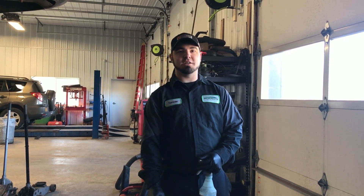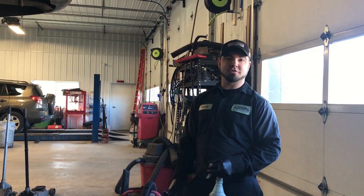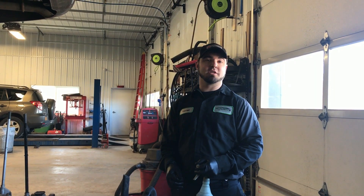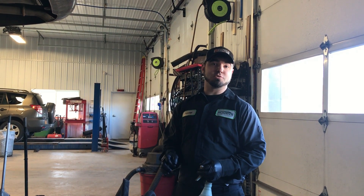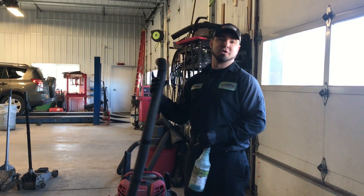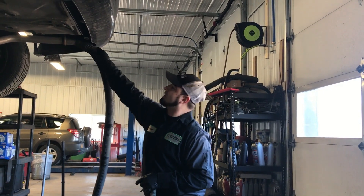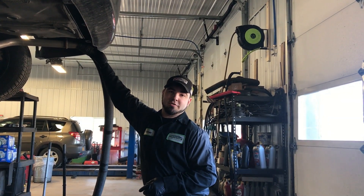The way we're going to do that today is we're going to use a shop vac. We're going to take the air hose off of the suction side of the vacuum, make sure that the inside of the vacuum is cleaned out, and then we're going to put the hose on the side that blows air out of it. Once we do that, we're going to take the shop vac and hook the other end of it up to the tailpipe of the car that you're working on. You're going to need an assistant to hold that on there, or you're going to have to tape it on.